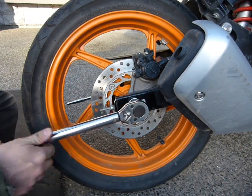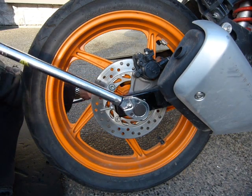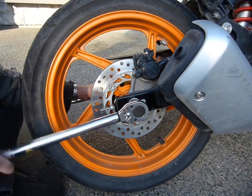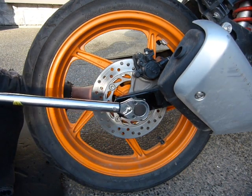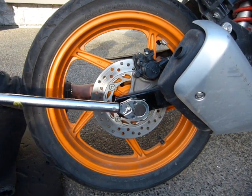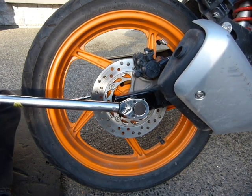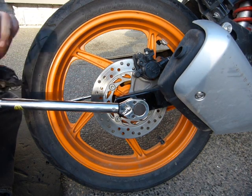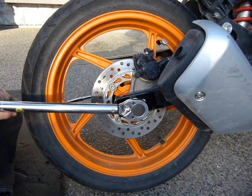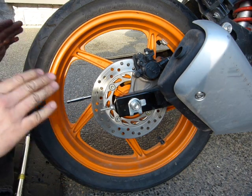There's a little lock mechanism at the end. This ratcheting sound is not the actual operation of the torque wrench — the torque click will also be a click but it's going to be a different click, so you're going to have to listen carefully. I'm just picking up the slack on the thread. Listen for one loud click — there. Don't rotate the torque wrench any further than that.